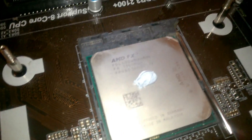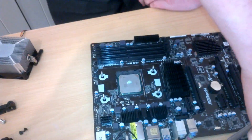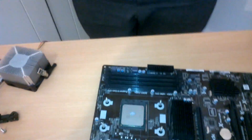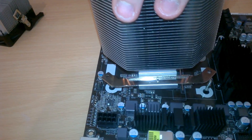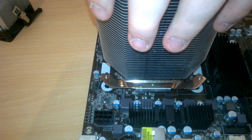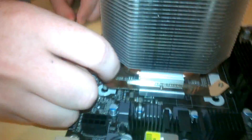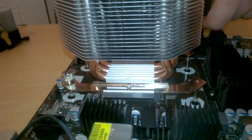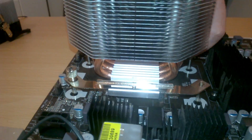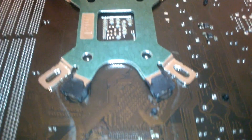The CPU is cleared off, and I have just a little bit of thermal paste on there — around a pea size — in roughly the middle of the CPU, and we have our CPU cooler here. This is just going to go down onto it like so. There's the cooler installed. You can see the back plate and the actual cooler itself.